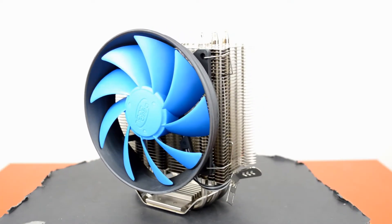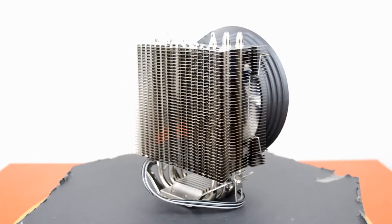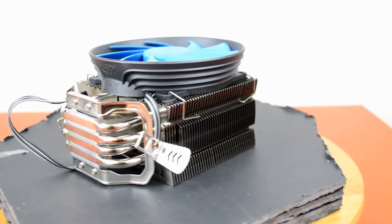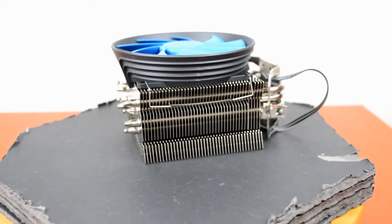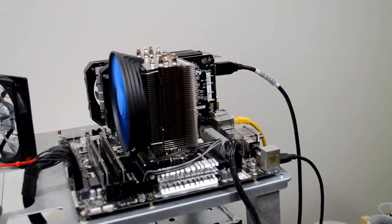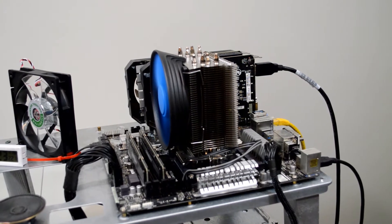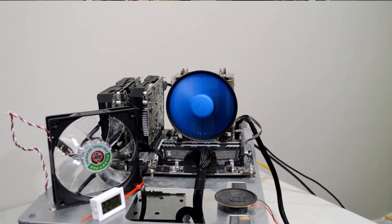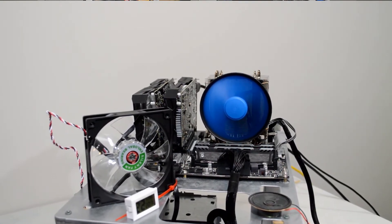Let's start by taking an overview of what the cooler is offering. The Gamax S40 features a standard tower cooler design with four 6mm nickel-plated copper heatpipes. It also comes equipped with a 120mm PWM-compatible fan with a max RPM of 1600. As Deepcool describes, it comes with a double airflow design in its aluminum fin stack, which is supposed to help redirect airflow to other components in your system. The S40 has universal compatibility with all modern sockets, Intel and AMD, including AM4, right out of the box — no adapter or extra kit needed. Overall dimensions are 143mm tall, 120mm wide, and 81.3mm thick.